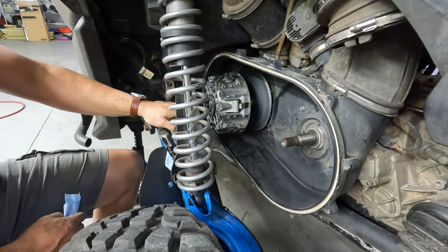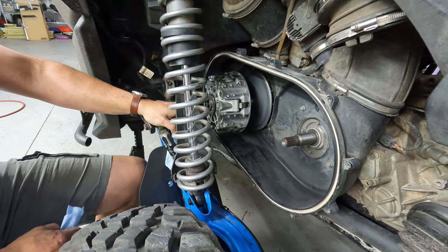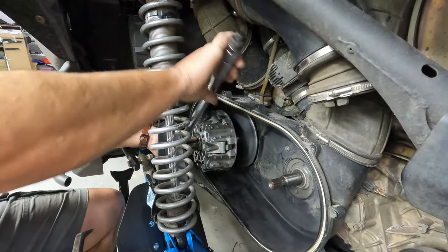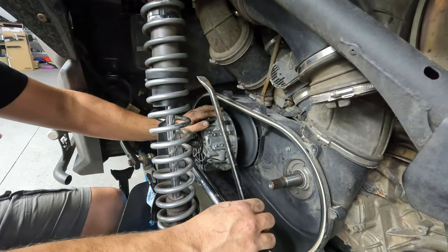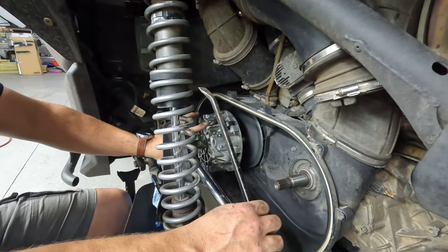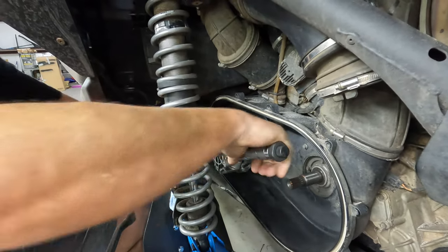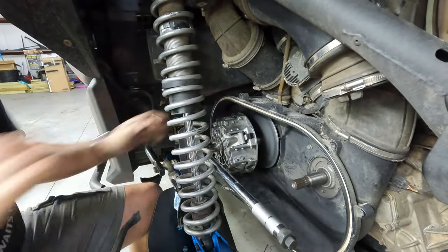So next up, I'll grab the torque wrench and torque this down to, I think it's 89 foot-pounds is the factory specification for that. All right, if you don't have a friend or somebody else to hold this primary clutch still, that's what the pry bar is for, because there's no good way to hold on to this thing. What I usually do is I'll run in a couple of bolts up here and I'll keep the pry bar down low. But I'll start the torque and I'll get it till it can't anymore, at least, so I'm not sitting here holding it any longer than I have to.